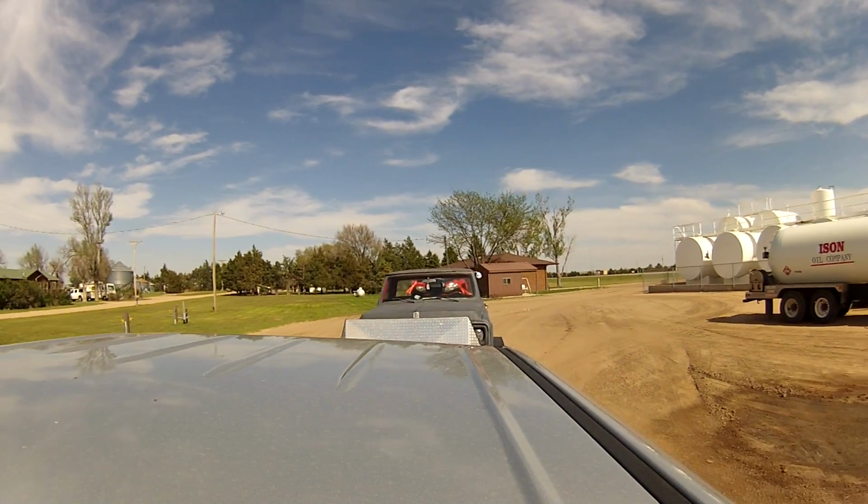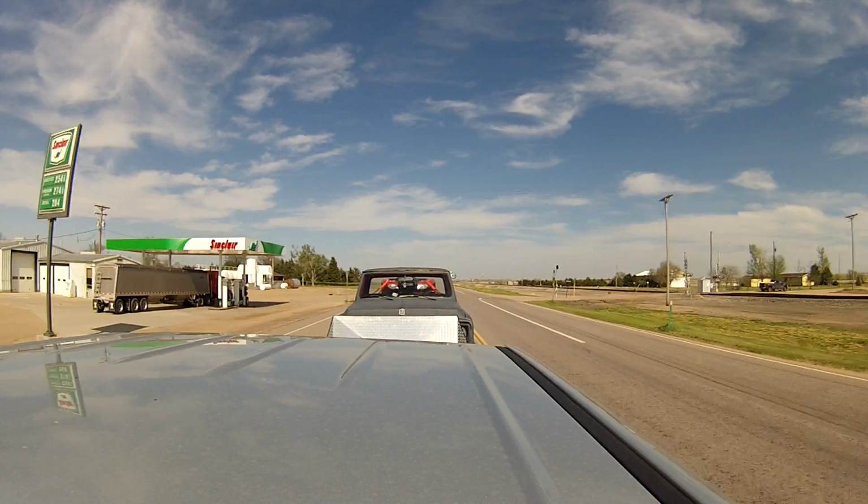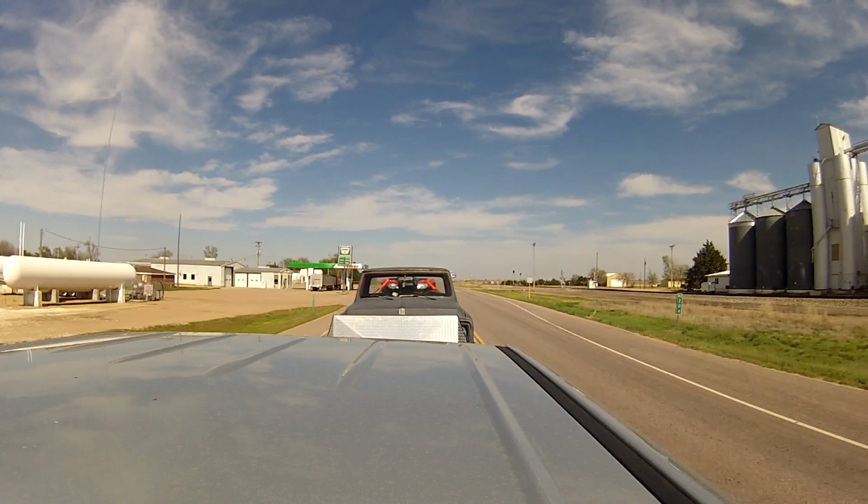It's having no problem pulling this 8,500 pound trailer though. Listen to that American V8 rumble. Love that power. Yeah, 420 horsepower, 460 torque. And the maximum torque comes on at 4,100 RPM, which is way up there. That's what a V8 gas does. That's why they don't get the same gas mileage that a diesel does. The diesel's power comes in way low.